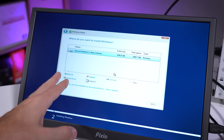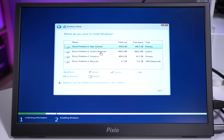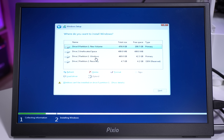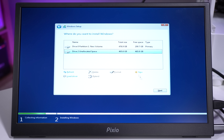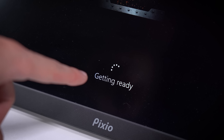It's not going to make a real difference because both drives are limited by the SATA interface, so they'll earn around the same speeds. We need to delete all of the drive two partitions — two and three. We've got this heap of unallocated space, and we're just going to click Next and Windows should begin installing.